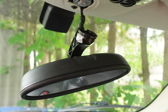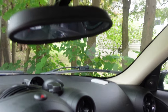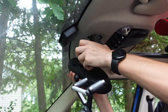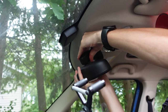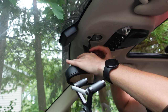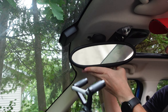The best part about this is there's no programming required — it just works with the key fob. It's really just receiving the signal and sending that along to the car. Let's go ahead and put this back together. We take the plastic housing and we do have to adjust the mirror to fit it in there because it tucks into that little socket in the back. Snap it together, make sure you've tucked the plug back into its little housing in there, then feed the cable up slowly and put this right back to where it was.